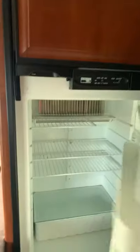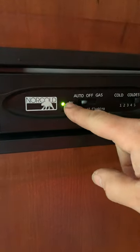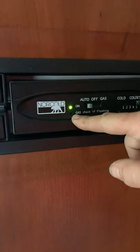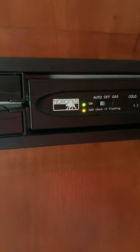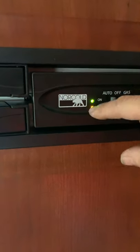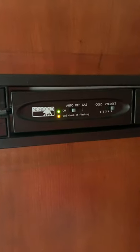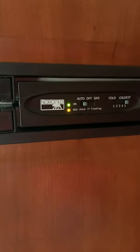Your refrigerator is off right now. All you do is turn it to auto. It will show on, and then you'll have a gas light come on saying it's running off of gas. Anytime you turn the generator on or if you've got power, this light will go out and it'll just be running off electricity. Anytime this is flashing, there are two things to check: one is your gas is not turned on, or two is you're not level — you need to level your RV up a little bit.